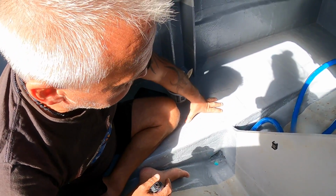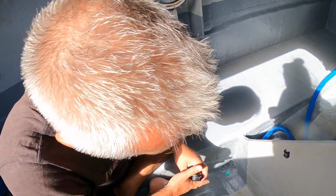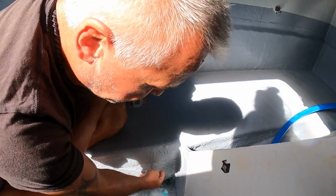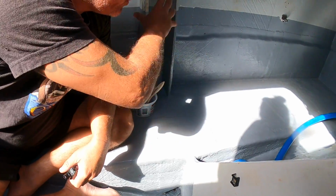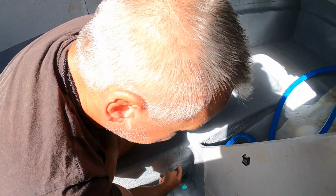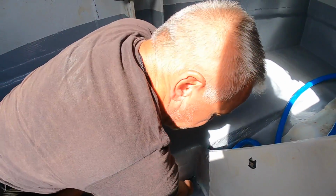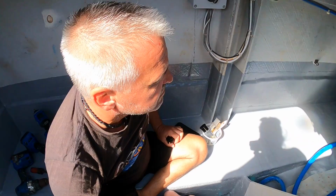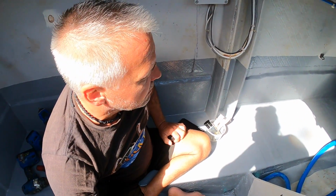But as you saw when I was building this up, there's a sloped part I've now put in here. It goes 7 inches down to the shelf. So I am going to put a hole there. So if any water does get from the mast through what I've built here, which I have no idea how that would happen, it will have an exit hole down to there. And we'll also leave the original one open. So once you do these holes today, you're going to put 5-minute epoxy around it just to seal up anything? Yeah.